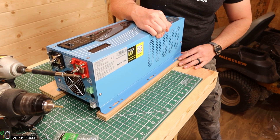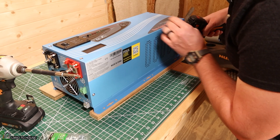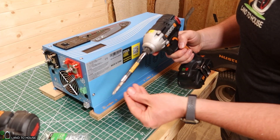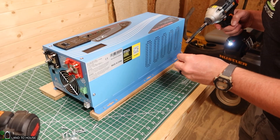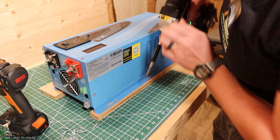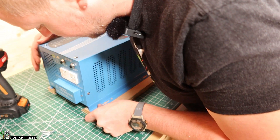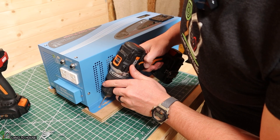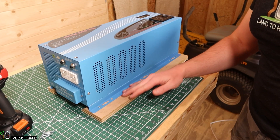I've just centered that. Hopefully I can get these screws in here — there's not a lot of room to work with, so they may be a little bit angled. I'm hoping my sleeve will help drive these in. This bottom piece won't be holding any weight, so I'll just put three screws in to keep it on nice and tight. I'm using a screw as a spacer because I want these to be the same on both sides — otherwise whenever one side of the cleat fits on the other one, it'll be a little bit off. This top side is going to be holding all the weight, so I'm going to fill in all of these screw holes — that should give more than enough strength to hold up 50 pounds.